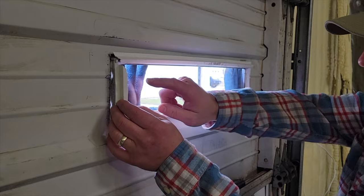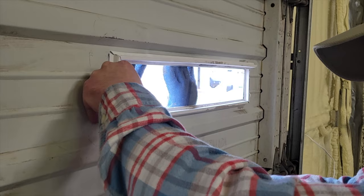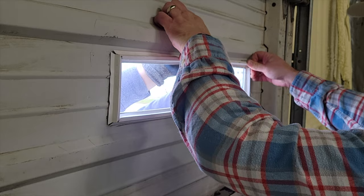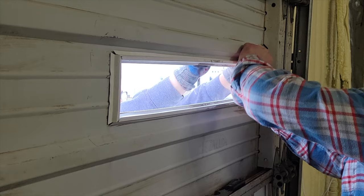When you're putting the frame back on, get yourself a buddy on the outside. I got my neighbor at my warehouse complex to stand outside and hold the window frame in place, because if you just push it out, the window will just pop out. You can see how she's holding it in place while I snap it back in from the inside. The whole door is moving when I push, so you need somebody there to hold it from the other side so you don't jam it through and pop the whole window frame out.